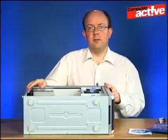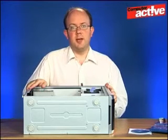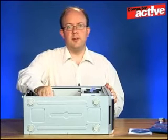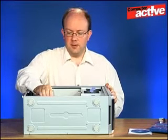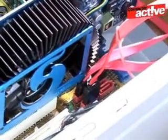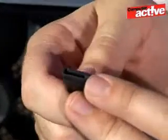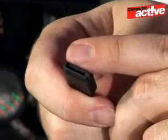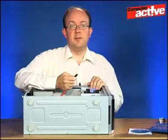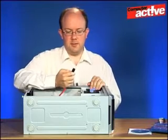Now we need to connect the drive to the motherboard. There are two cables you need for this: the data cable and the power cable. On our computer we've got four SATA sockets, two of which are already in use. So we're just going to plug the cable into the next available one and then plug the other end into the drive. One of the nice things about SATA is that the drive connector is keyed slightly — there's a little lip and that means it's impossible to put the cable in the wrong way round. If it doesn't seem to be going in, don't force it — remove the cable, have another look, and try again more gently.